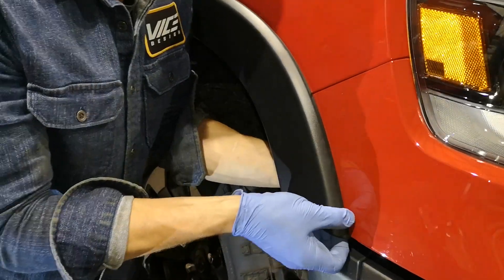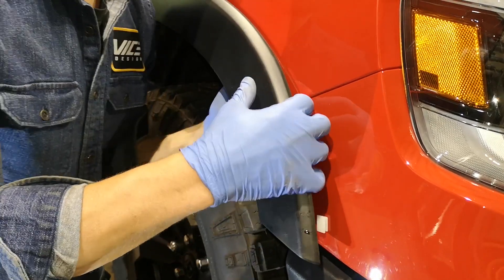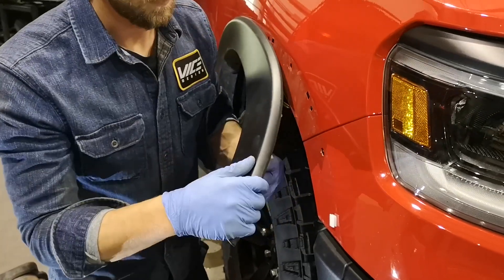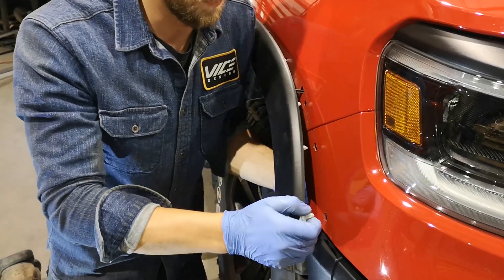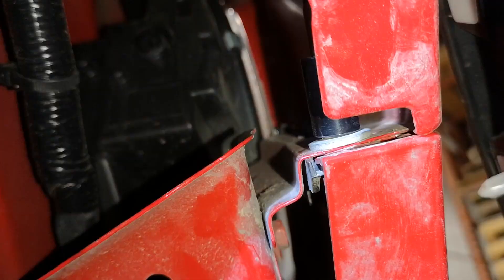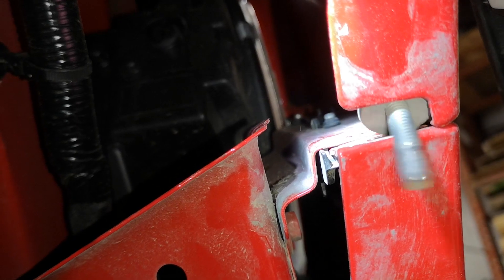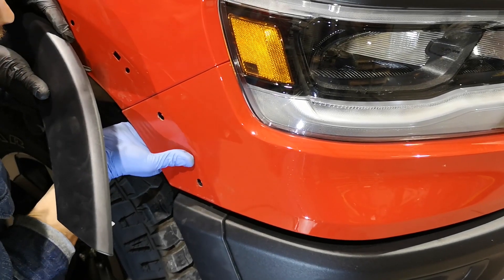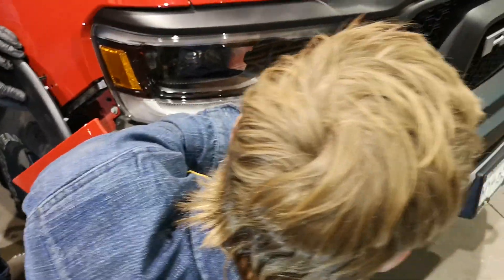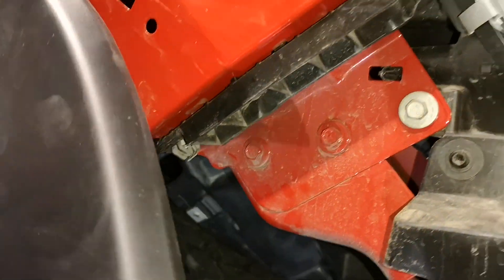If your truck has fender flares, separate them from the front body panel — move slow and work your way from front to back. If a bottom clip stays behind, separate it and reattach it to the fender flare. Inside the fender there's a 10mm head fastener to remove — the right angle tool is handy here. One of the trickier parts is the headlight bezel: use your finger to pry down on the black tab, flex it, and pull the fender out to release the tab. Repeat this for both sides of the truck.